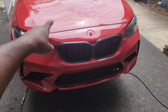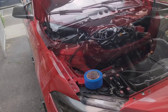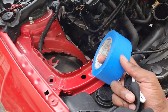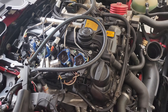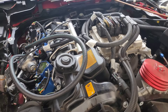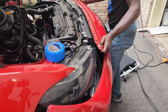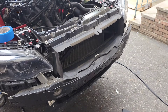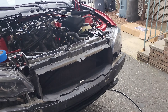We're going to remove the bumper, then remove the crash bar, and we'll be removing the engine out of the car. We're making some progress — we got our tape for labeling stuff just in case we get lost. To make things easier, we're removing the radiator, but first we have to drain the fluids.